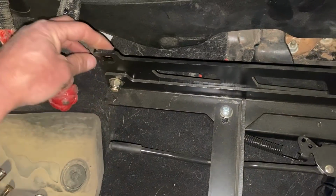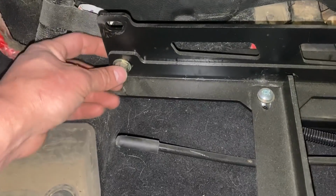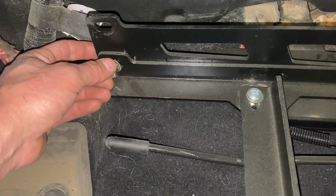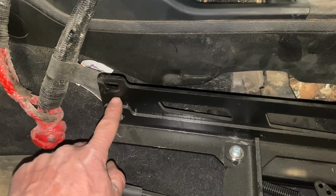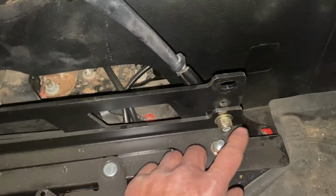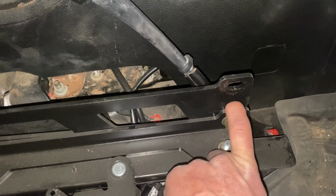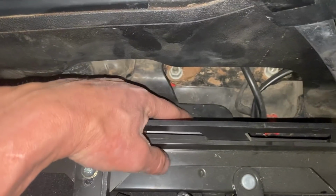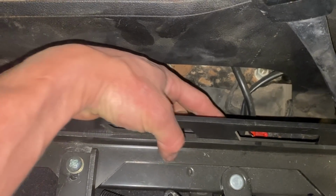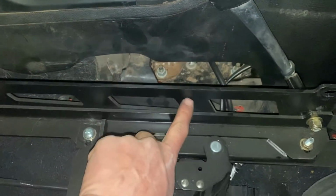While Kevin's up there grinding away, we got the seat out. So what we want to do is we're gonna lower this. So I need to pull this bolt, lower this side rail about 1 inch on this side and drill another hole. And then back here, we're just gonna pick up this one hole that exists. So we're gonna lower this whole thing 1 inch. And if you remember, I think this bracket's in the way, so we might have to just notch the bottom of this bracket.